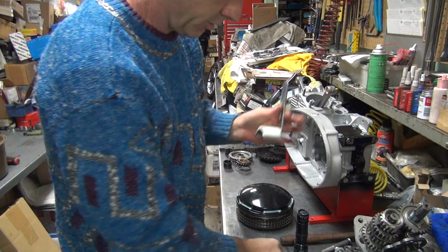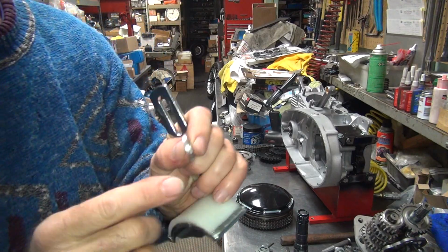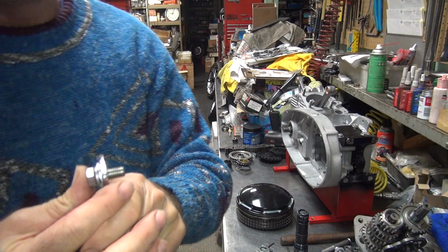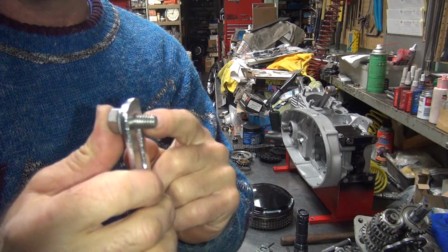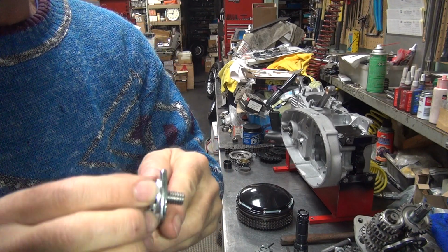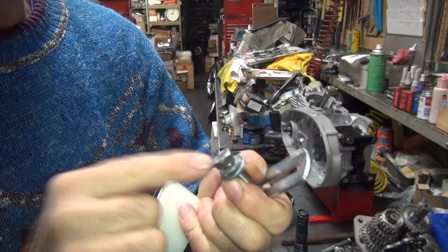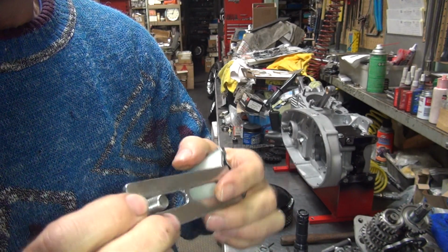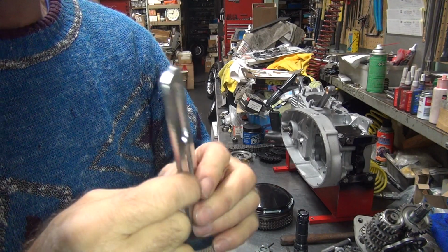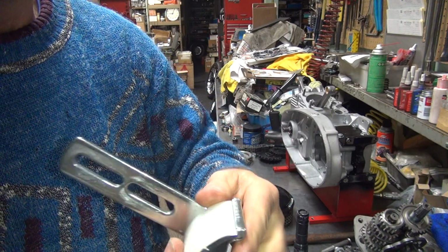Stupid bolts here are supposed to hold this on. These little thin washers aren't gonna do anything either. If you torque them too much, you'll strip those threads out. So we're gonna put a stronger washer on here because these little thin ones are just gonna buckle under. And we'll get some real bolts, and start with something a little bit longer. And this thing here is made out of some real tissue paper thickness material, so I'm sure it's going to bend and just fall off.